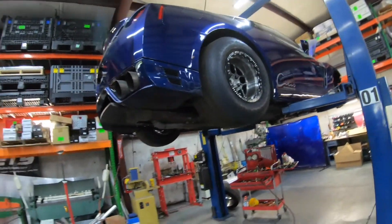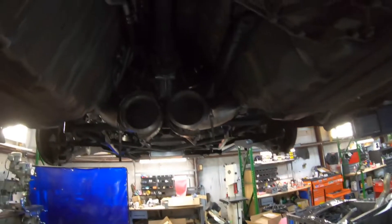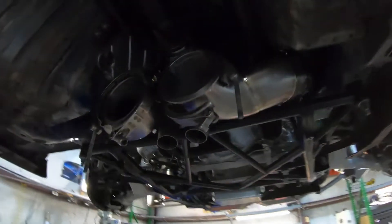So one of the things we've got going on is the shop car here. I'm putting a full exhaust system back on that car just because I've always wanted to, and we're actually custom building that out of titanium. We're doing full four-inch down pipes into a four-inch Y pipe into a full exhaust system, so I can get a little bit more street time in this car, which I'm excited about. I'll give you guys a little teaser of what that looks like.